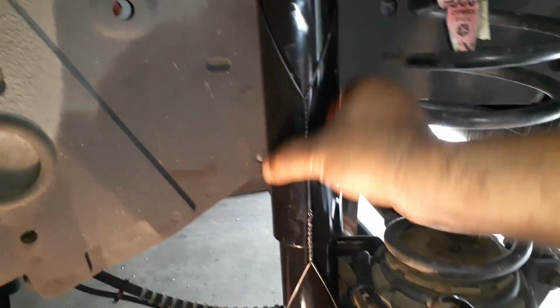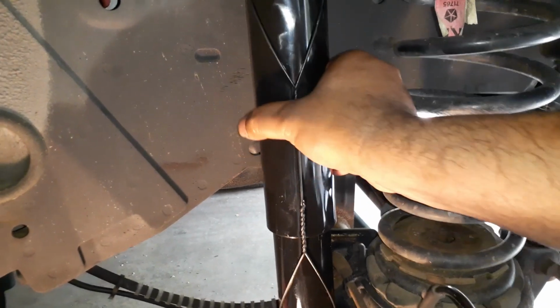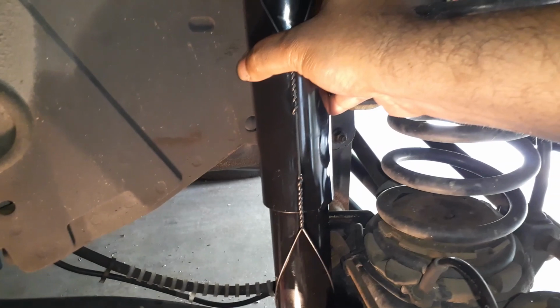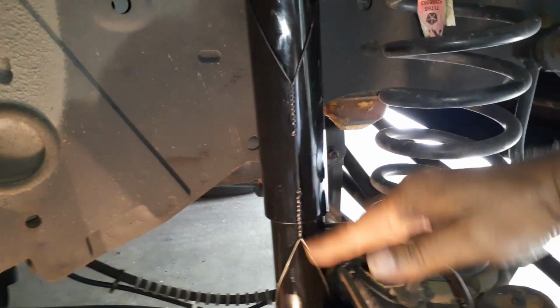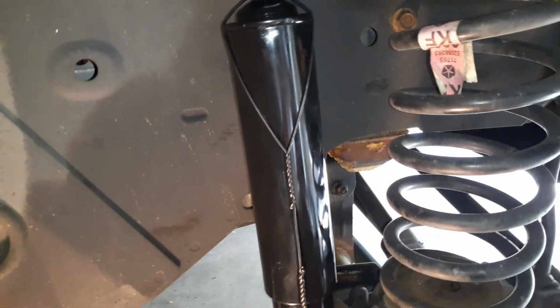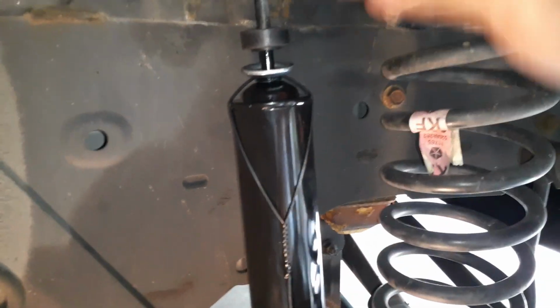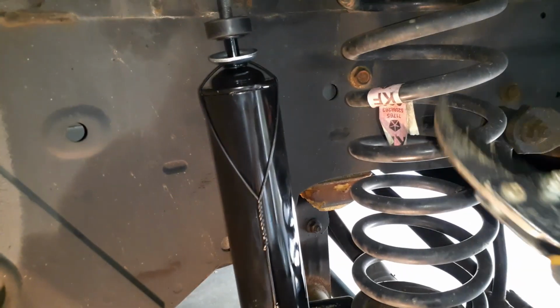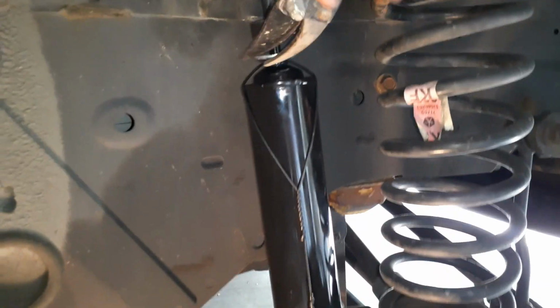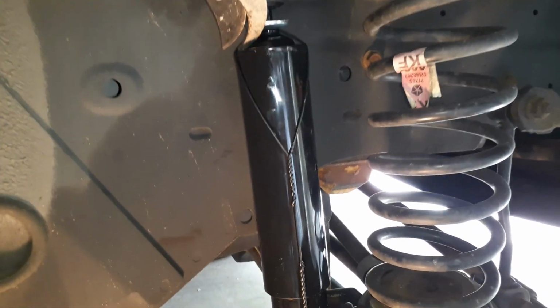One thing is, you might hear about priming these shock absorbers. For Gabriel ones, you don't need to prime. You need to just let it sit in this position, and it will automatically distribute the oil and the gas inside. But in case you want to do it, then you have to take it off and pump it like 3-4 times. So I'm going to use any kind of clippers to just clip this.